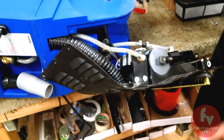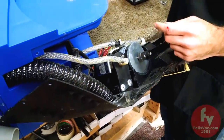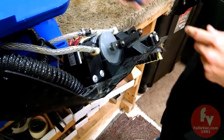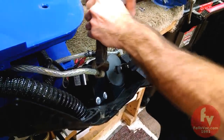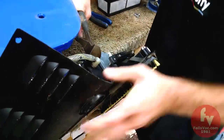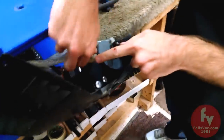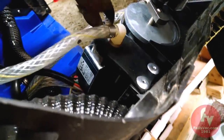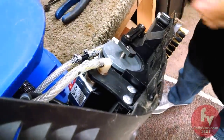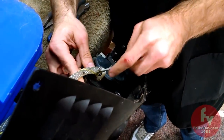After noting the direction of the flow, now we have to cut off these clamps, which is easier said than done. They're not easy. They show to use a cutter. We have cutters like this, right here. It's supposed to be able to just cut them. I've never been able to just cut them. What I found for me is an acceptable, reasonably easy way to do this: these fittings have a seam on the bottom. So I try to spin the fitting so that I can get into that seam. Pry this, get it started, and then it just pops straight open. That's what I do.